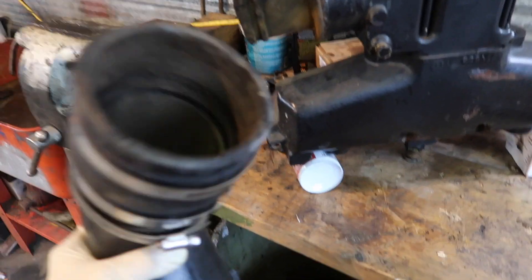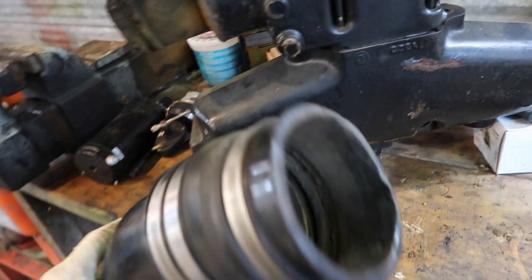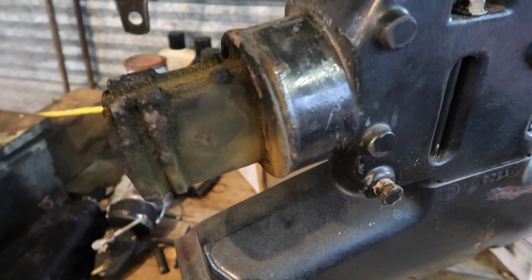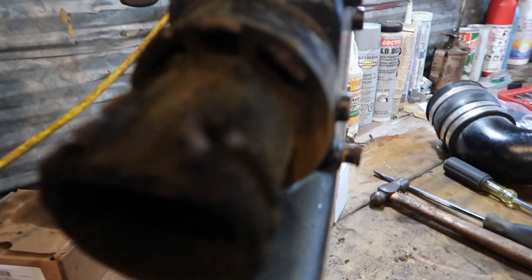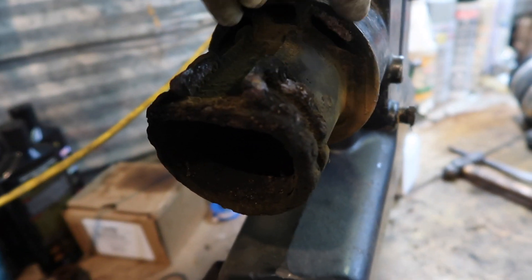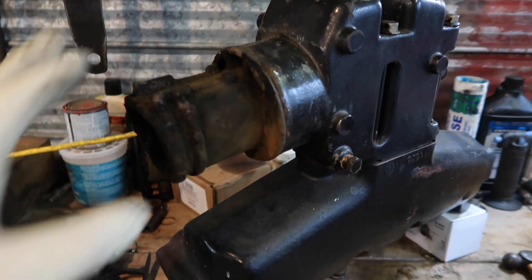There's the back of our manifold — it's just a rubber boot or bellow, then metal again. It goes over there like that; they're fun to pull off. There is a lip on there — if you can heat them up that's best; in summer they come off nicely. This is the point where water starts mixing with your exhaust. Being on a downhill slope, water ain't running uphill. The water comes through the water jackets of the exhaust manifold and comes out through these holes — that dinosaur-looking fitting right there. The water comes out, goes around, and that's where your dry exhaust and wet exhaust mix.